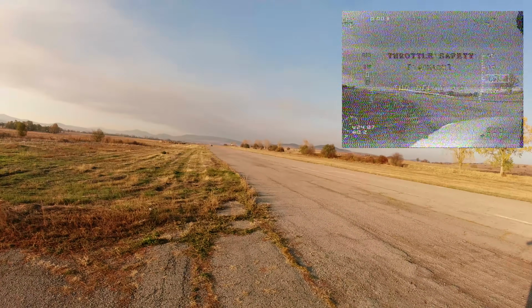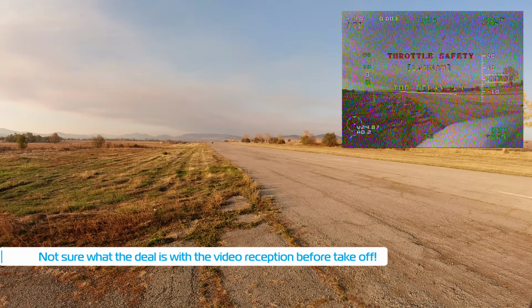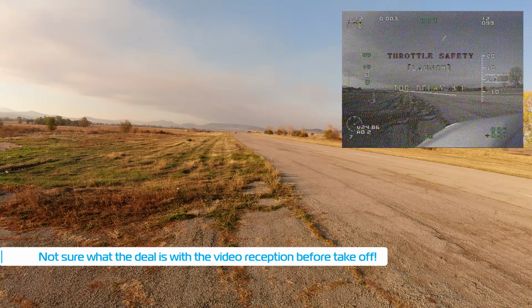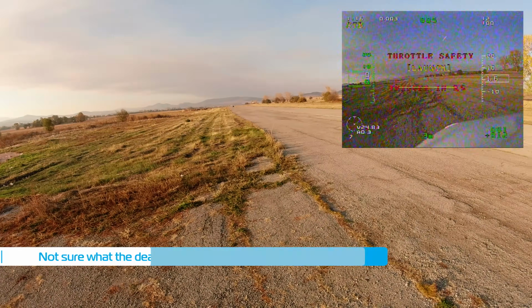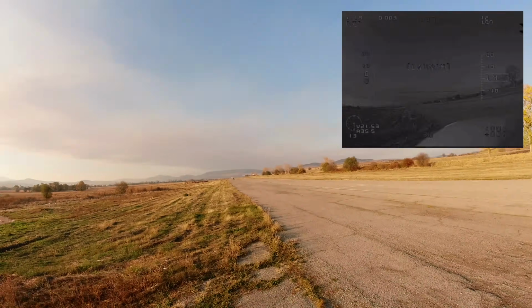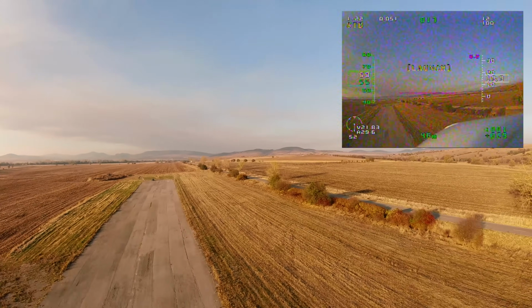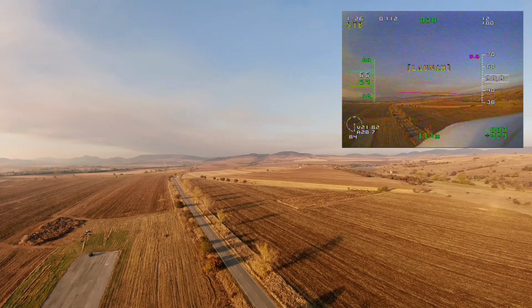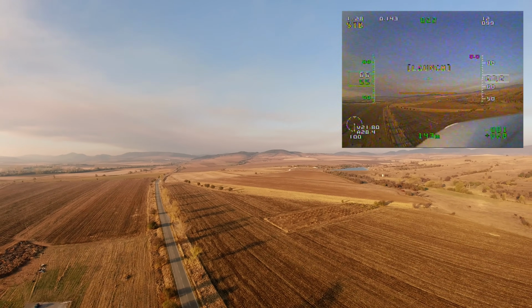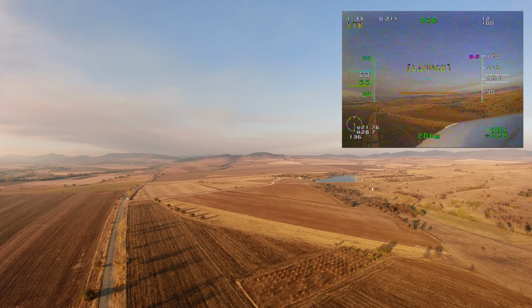Shortly after, I decided to do a range test on the receiver only, but this time the micro one on the Crossbow mini plane, starting again with 100 milliwatts on the transmitter module, but no telemetry this time. I flew out from the same location and in the same direction, and to my surprise, I was able to get a darn good distance away before I felt I should switch up to the 300 milliwatt option I had programmed for the second position of the switch, just in case.